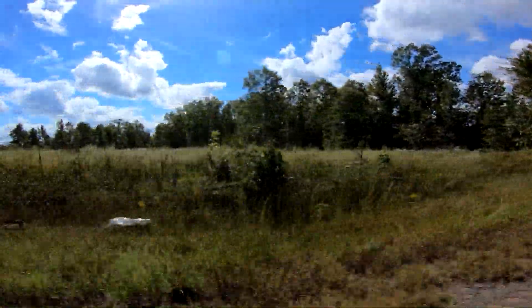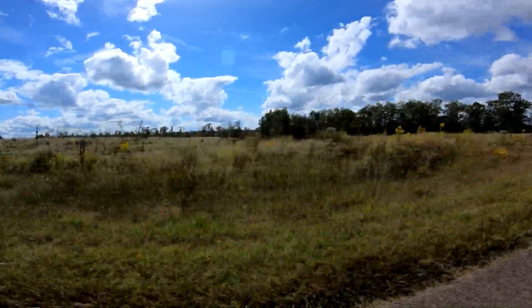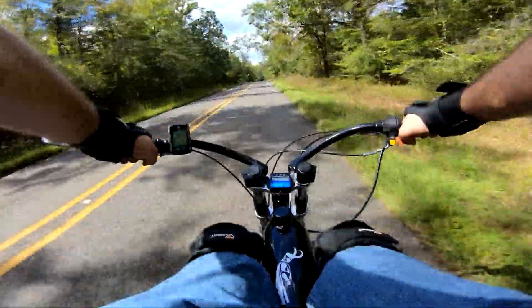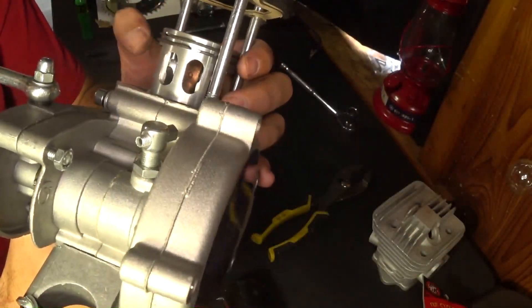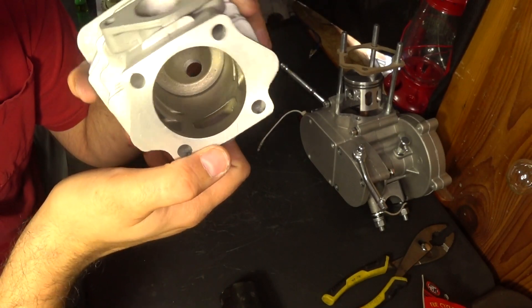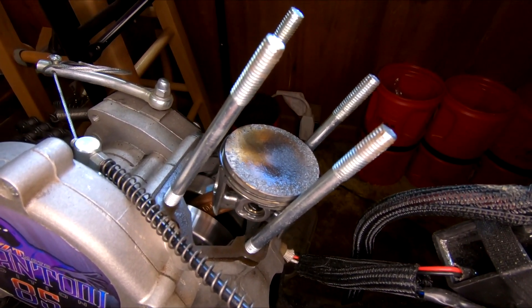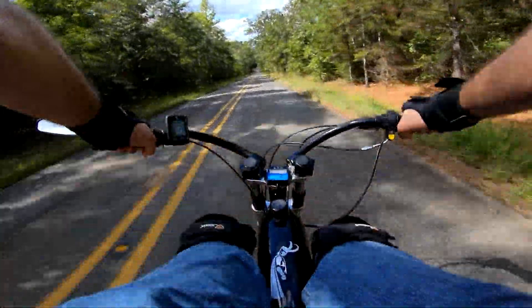This is where it all falls down to price. The designers knew these motors were going to be made quickly and with low quality parts: thin cast aluminum bodies, relatively soft bearings, subpar cylinder linings, thin chains and sprockets, no forced air cooling, and would be subject to poor riding conditions — just to name a few. Not to mention, most of these would be going on equally low quality bicycles. They knew full well that offering a high revving, high torque motor within these conditions would only leave them with a lot more broken motors than we already see. A good example of this is the first generation Phantom 85. It has a more aggressive port map and considerably wider piston that offers a night and day difference in raw power, but requires the use of more expensive ceramic cylinder lining, thicker supports for the crankcase bearing, a reed valve to take advantage of its port map, a higher quality exhaust, and the price reflects it. Sadly, these measures were not enough to stop a nearly 100% failure rate due to an overlooked conrod bushing, which also needed to be upgraded.